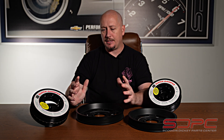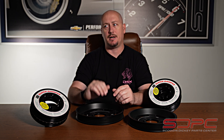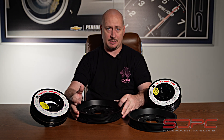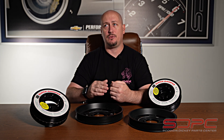Be mindful of your blower speed. There's a lot of discussion out there — sometimes it's good data, sometimes it's bad data, and sometimes it's just conjecture. But we do have a lot of companies out there that have charts that can help you understand what you're doing with your supercharger to find the boost target, your power target, as well as making sure that you're not getting into a blower speed that is dangerous for your blower, which in turn can be dangerous for your engine.